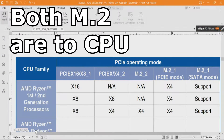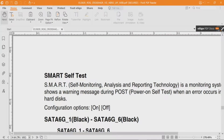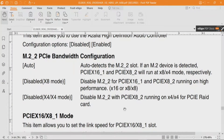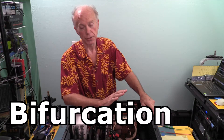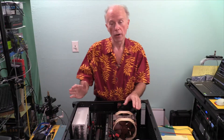One more piece of information we need to look at is bandwidth — that's on page 78. I had to do some digging for this one. Right here: M.2_2 PCI Express bandwidth configuration. This is arranged a little backwards from how it should be, and was a little odd and difficult to find. We're going to go through this and explain it because there is some bifurcation here. What is bifurcation? As we look at one of the quad cards, the requirements are two things.